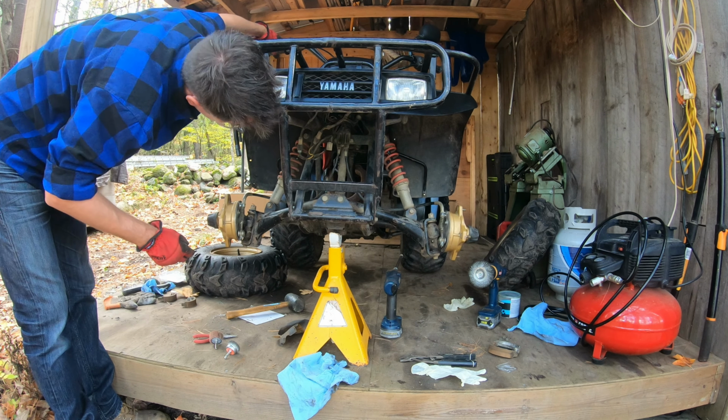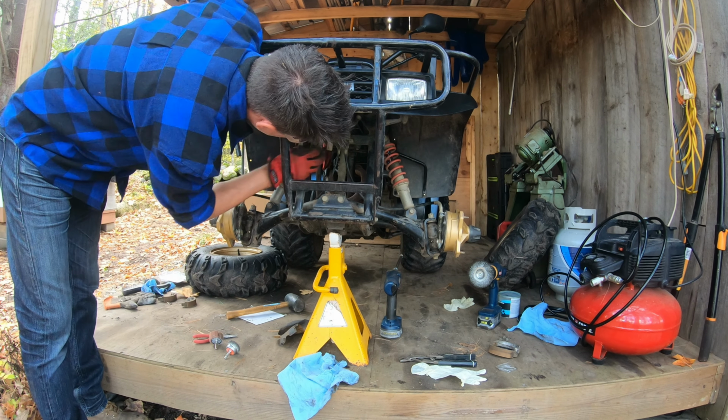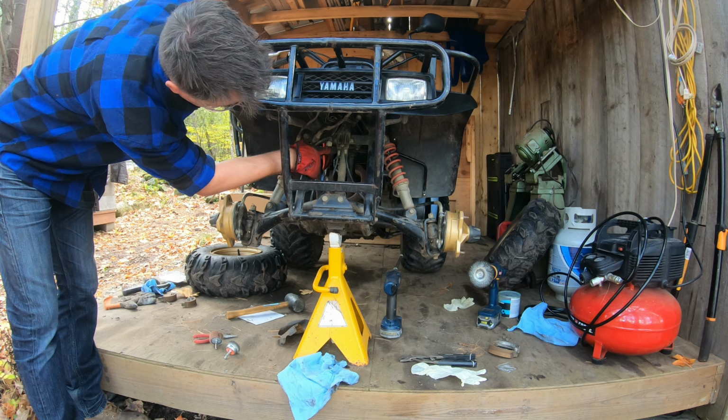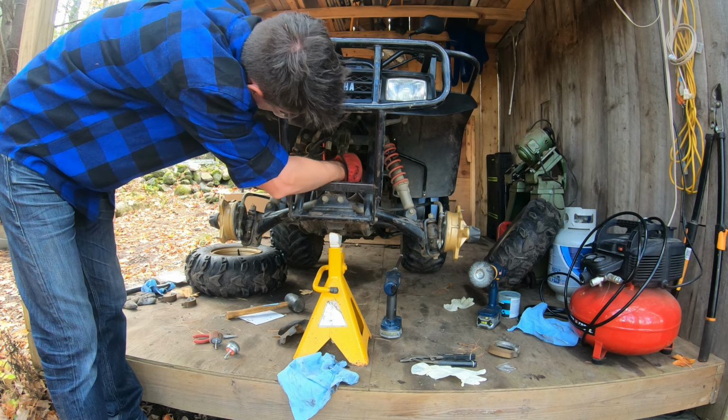Try this again. Pull better, still high on the left. Now still, we have more tightening to do. Bring the tension off. Everything's back down. Really want to take up that little slack there. Frankly, on both sides, we want to take up that slack. That's pulling almost even. One, two, three, four. I'm going to say five turns there. Everything's down. It's neutral position.